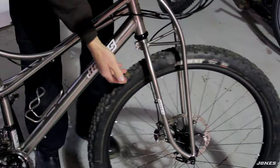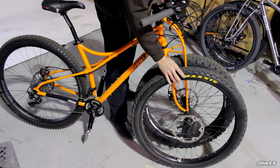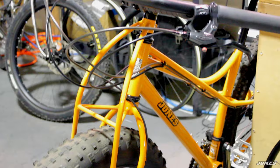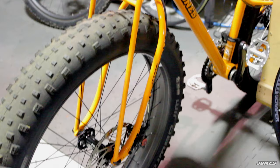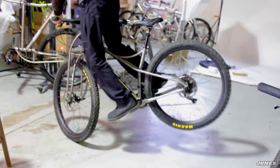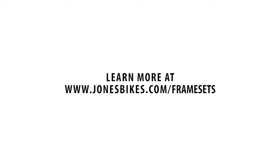You have a lot of tire clearance in the fork — enough room to run a fat front wheel. The 26-inch by 3.8 wheel turns out to be about the same height as a 29-inch wheel, so we can change between sizes. All the Jones 29-inch bikes can have a fat front wheel or a 29-inch wheel. Having the fat front wheel on the 29-inch is really nice — it absorbs bumps better and allows you to run over big rocks and ride across ruts without getting stuck. You can take this wheel out, put in a 29-inch wheel, or put road tires on and use it for road touring. So this bike can be set up for mountain biking, road touring, or whatever you like, just by switching out the wheels.